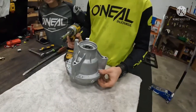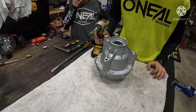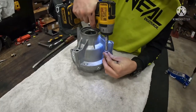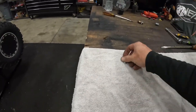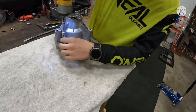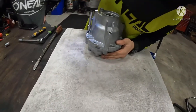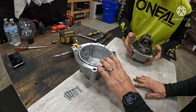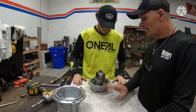We're getting the GoPro back on. This is a brand new differential and we're getting ready to disassemble it so we can remove the visco lock and then figure out how we're going to lock these bolts in. It's a T40 bit. It is a lot better being brand new — there's no oil on this thing. Normally when you pull them out of the four-wheeler they've got oil everywhere. This one just came from BNR Motorsports, which got it from BRP — Can-Am.